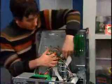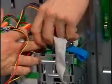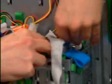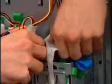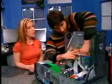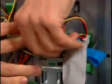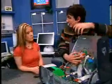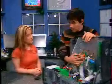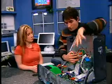Then you just flop this cable over and seat the cable. It's kind of difficult depending on the case — they're all different. It takes a little working and you have to make sure you get it right because there's only one way this cable can go in. You don't want to bend any of the pins. Carefully feel it out. I pushed the connector until I felt it snap down to the bottom — you'll feel it hit the base of the plastic connector. That means you've secured the drive. So now that you have your power and your cable plugged in, you're good to go, set up as the slave on the hard drive's chain.